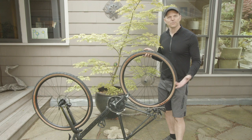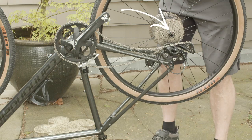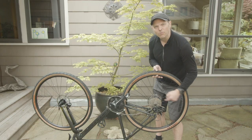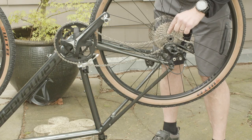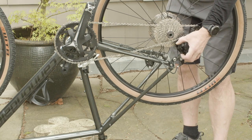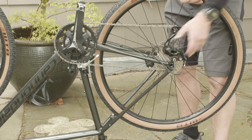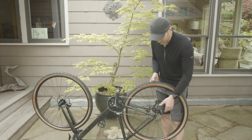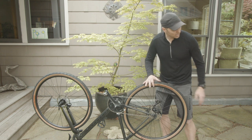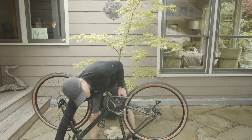We're going to take the back wheel — same thing as when we were taking it off — and move it into generally the right position. We can see from above that the axles are pretty much right above the slots they're going to drop into. Since we shifted all the way to the outside on the lowest cog before we started, we can take that chain and rest it right on that smallest cog in the cassette. Then I'm going to pull back on the derailleur, drop it — it's going to go into the chain below and drop right down into its spot. It doesn't have to be intimidating or difficult. I can see the brake rotor has gone in on the other side, and without the axle in yet it's spinning freely. Time for the axle from the other side — tighten until it's tight. Check the brakes.